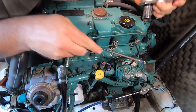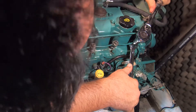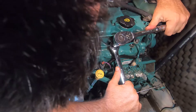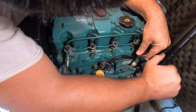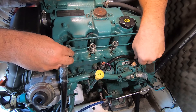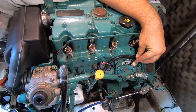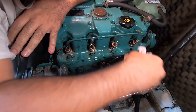With the fuel supply pipes off, you can remove the fuel return pipe. To do this you need to remove the retaining nut on top of the injector and counter-hold the injector itself so as to not bend the fuel return pipe. Then remove the screw on the banjo nipple - this is where those gaskets will be replaced on reassembly. Once the fuel return pipe is off, put that screw back into the banjo nipple just to seal up the fuel system and stop any contamination.